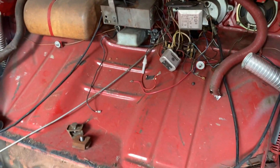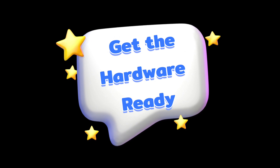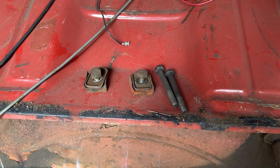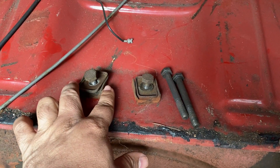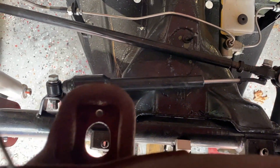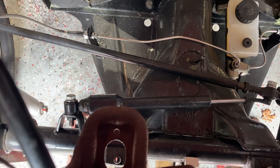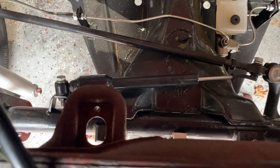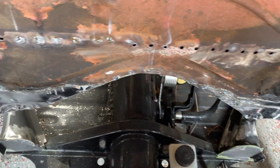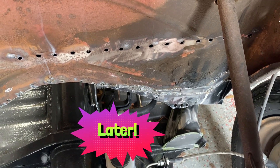The next step is, once that's installed, we're going to start lifting up this chassis and lining up with the holes. We're going to have some hardware here — I have the old hardware I'm going to use to attach the chassis, and we're going to use these as guides. I'm going to lift up on the chassis and try to line it up with these holes. Some guys use dowels, which is a great idea for getting alignment correctly. I don't have any wooden dowels, but I'm going to try to do it first try. You want to make sure that as you bring it up, you clear this firewall — sometimes the firewall gets in the way and binds up.